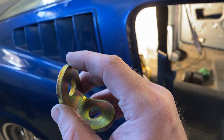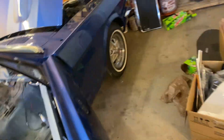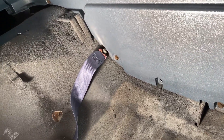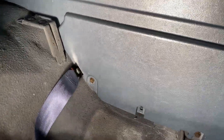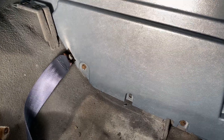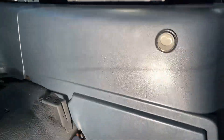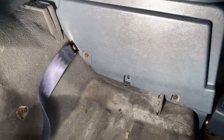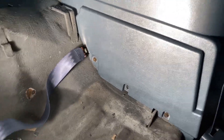That just gave me a little bit more clearance. I tried it both ways and for my application that worked a lot better. That's the rear lap seatbelt over there. What I had to do here is actually trim that panel a little bit for that screw. I had to put that screw in before I screwed down that panel, but I had to trim it out because the panel wouldn't sit flush and I wanted to be able to get my wrench in there if I ever need to loosen that up.